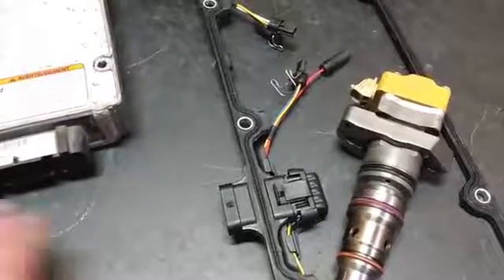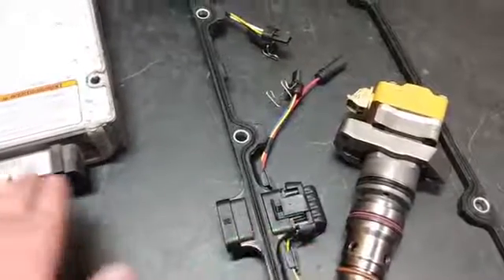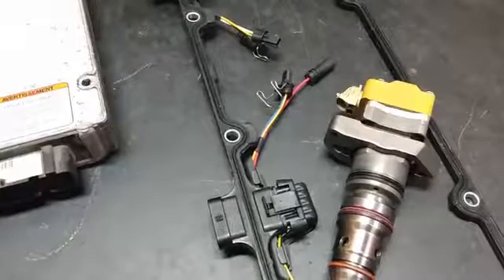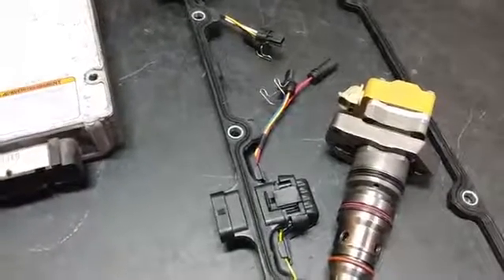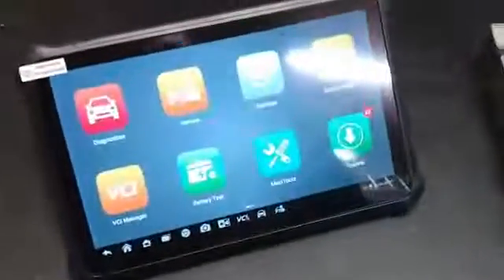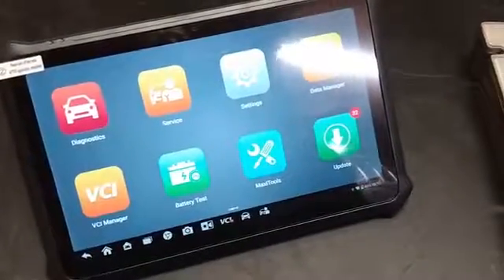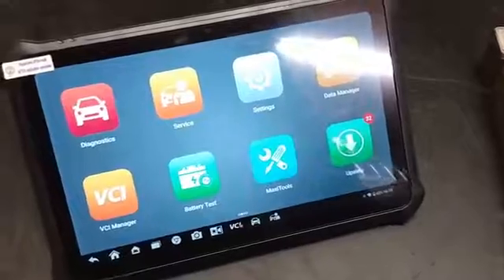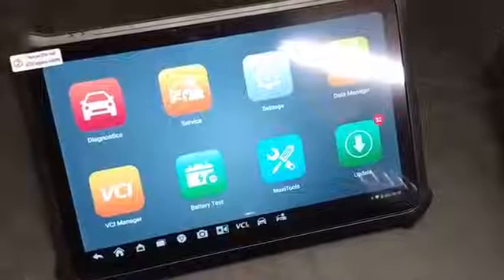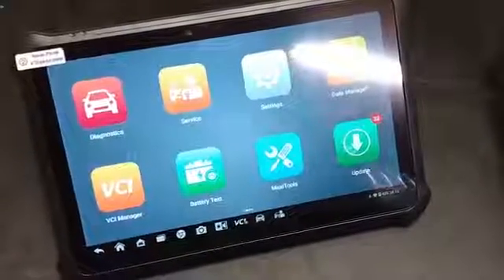Don't misinterpret that faint buzz as a bad injector. Realize that it is probably a wiring or circuitry problem to that injector, and you will need to proceed with diagnosis of that circuit problem. Also, at the end of the buzz test, the scanner will report codes — more than likely a high-low circuit code fault in the case where an injector is electrically disconnected. I'm going to go ahead and get the scanner connected up to a real vehicle, and we'll run a buzz test so hopefully you'll be able to see and hear that.